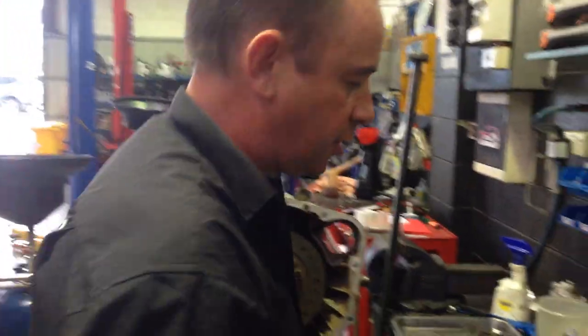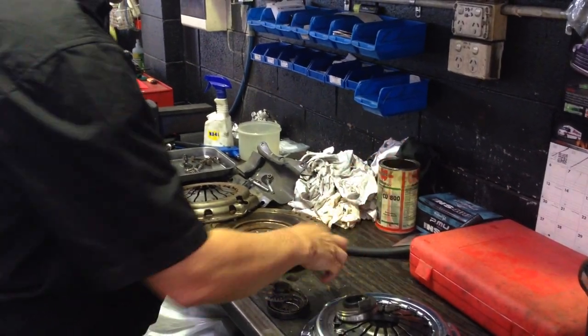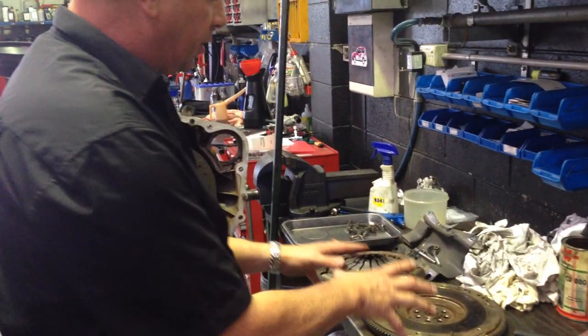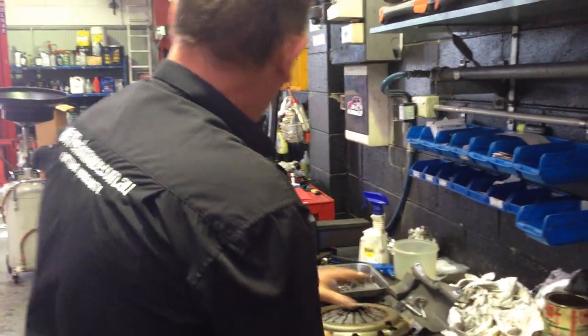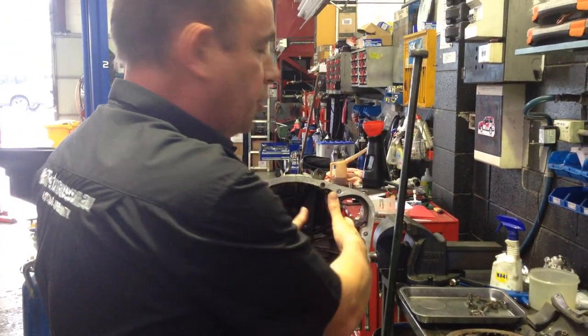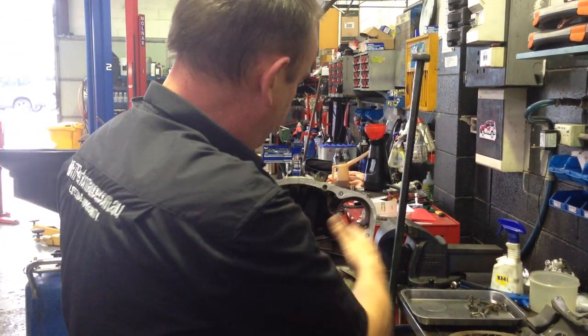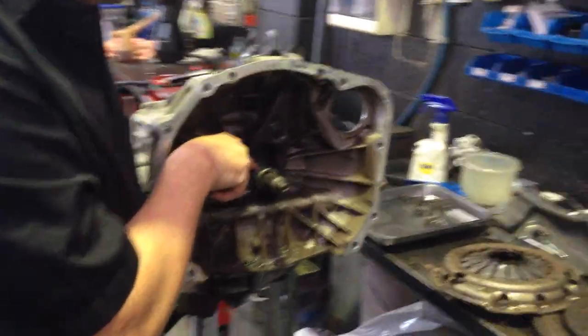As you put your foot on and off the clutch, unfortunately because this has been so poorly maintained, it not only needs a new clutch assembly, but this particular owner is now having to get us to pull all the components out of the back inside of the gearbox and supply two new gearbox halves to put it back together — purely to repair the damage that has been done.